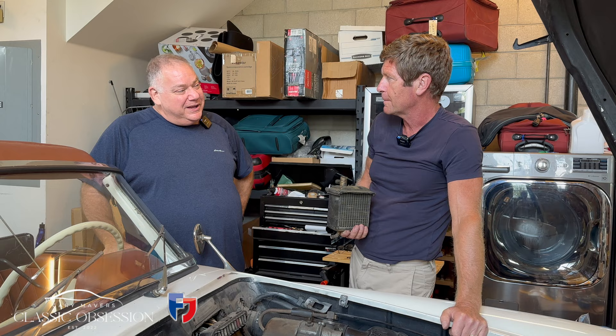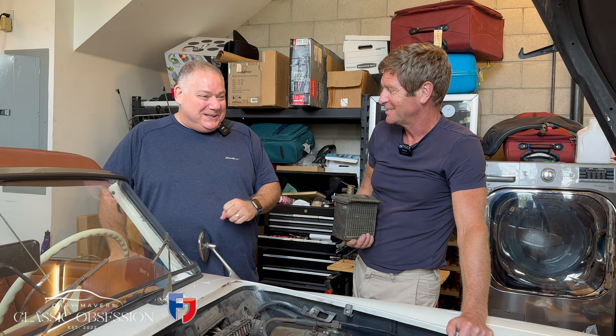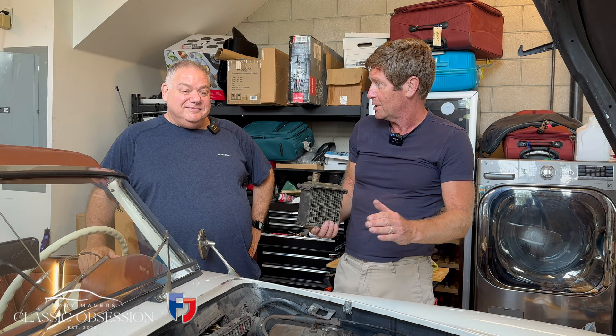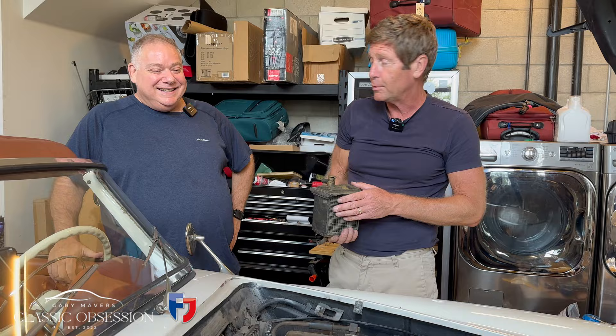But what's the clutch like? Can you remember? I think it worked pretty good. Come on, be honest with me. Well, I don't drive clutches that often, so I might have ground it a couple of times, but other than that I think it worked pretty good. These are famous for that. I could reverse and everything. Yeah, they're famous for it. It could be your thrust bearing, but I think the clutch will probably be locked up on this anyway, so we'll have to raise the back of the car, start it in gear — you normally hear a crack, a big bang, and it's freed up. I think your slave and your master will be gone on it, so we're going to replace all of them next time anyway.